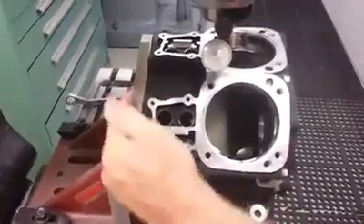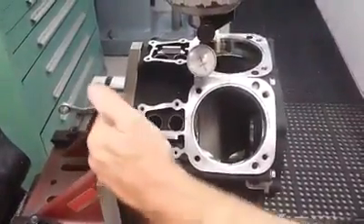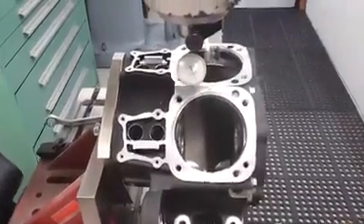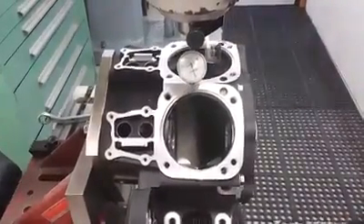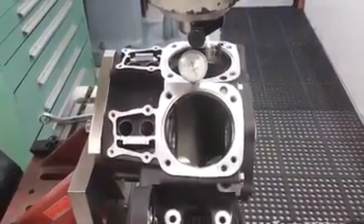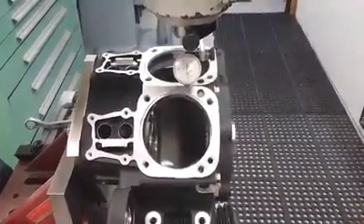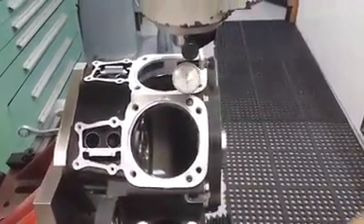This area here is where everything is machined from on Harley-Davidson, so this is a parallel reference. As you run this across there you'll see you only get about a thousandth to three-quarters of a thousandth drop, but then when it comes over the split of the case it will drop about another two thousandths and then continue.